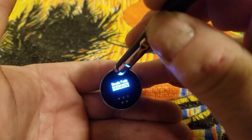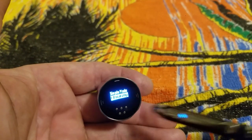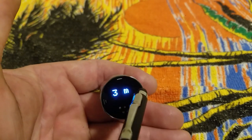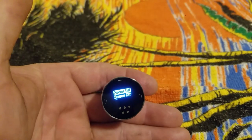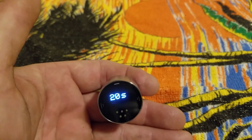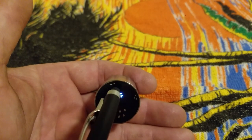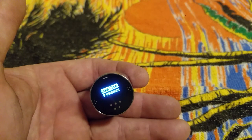At the end of this video I'll explain the two circumstances that get you 300 hours standby versus 18 hours standby. Next is power off — hit the top button to select, and scroll up and down to set the time in minutes. I'm going to set mine for two minutes, so after two minutes my gauge will shut itself off. Screen off is when your gauge is on but the screen turns itself off — that's measured in seconds. I'm going to set mine for nine seconds, then hit the top button to select.